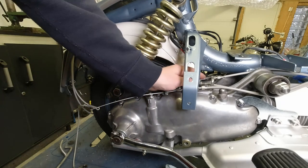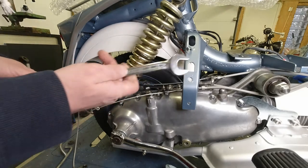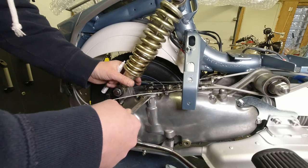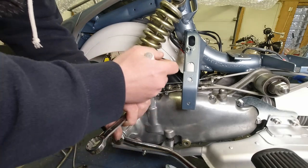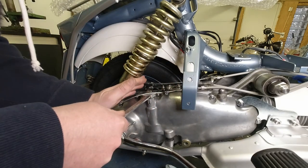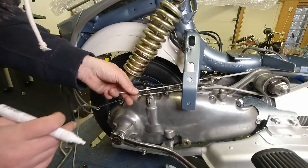The same with the gears, I put the adjuster so it's about halfway, so you've got movement both ways, which is pretty important. I take this wire here, I use my trusty 19mm, and I turn it until I can feel it's engaging here, and basically if I hold that, ugh, you little bugger. Not easy, is it? I just put a little white dot there, and that's where I want the center of the trunnion.